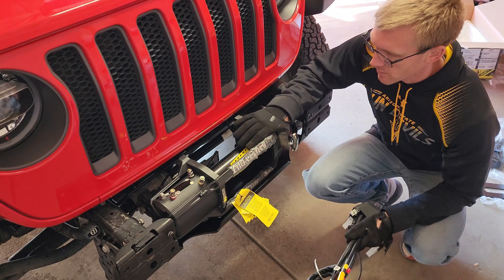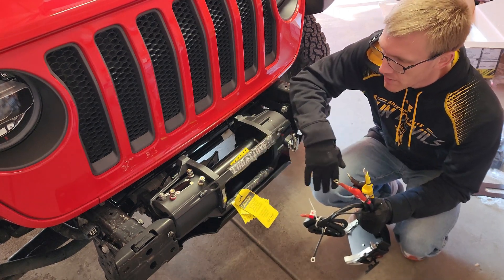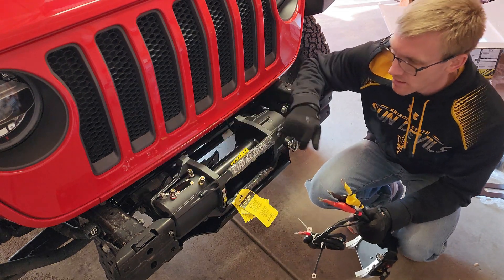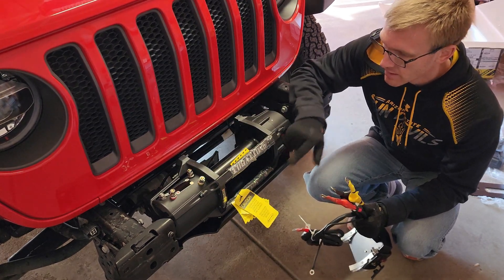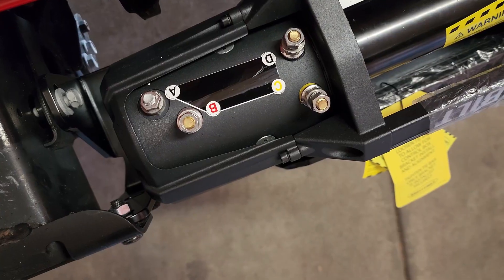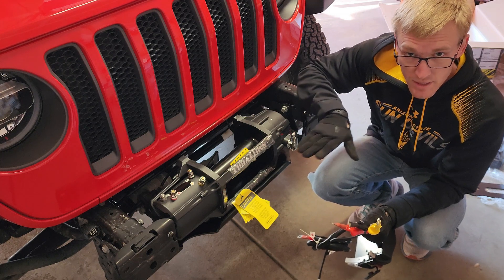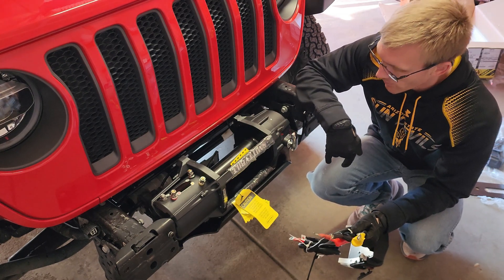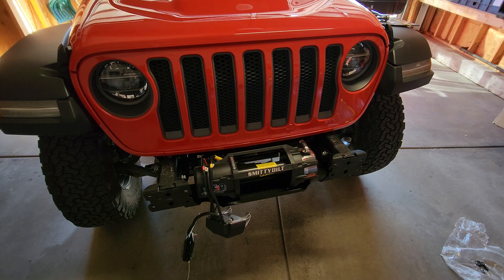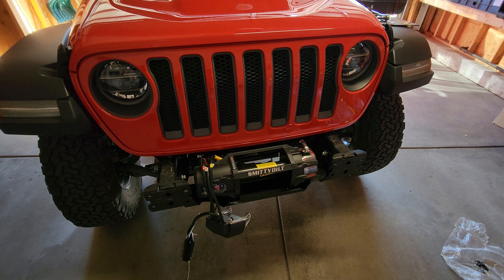Though I said we were going to bolt this down, I've turned it on its side because we need to connect up the electrical parts that are going to give the winch power. Once I stick it up there and bolt it down, it's going to be very difficult to get my fingers and these wires all connected and make sure they're tightened down really well. So what we're going to do first is connect these and tighten them down, and then we'll put the winch. What's really cool about this Smittybilt winch is it's got these letters, and on these cables we have the letters, so it tells you what cable goes where - you cannot misplace the cable. They have literally made this stupid proof. Where do we place the housing - do we want to place it on this side, do we want to place it in the middle? Let's find out.